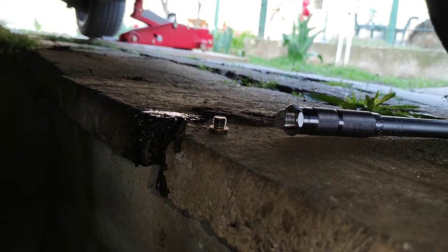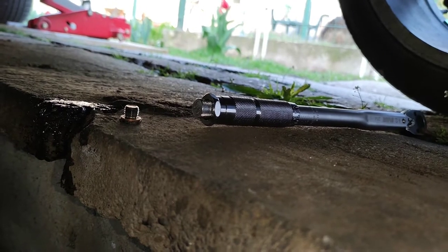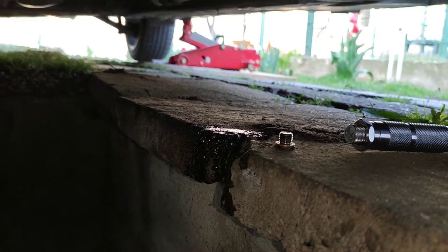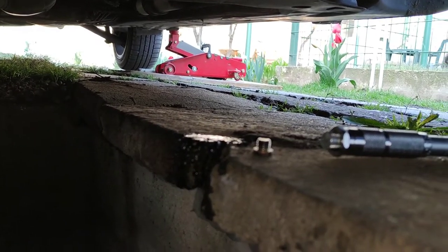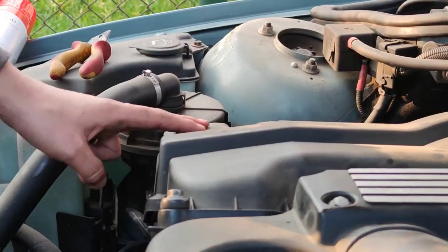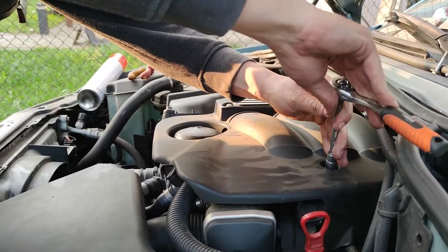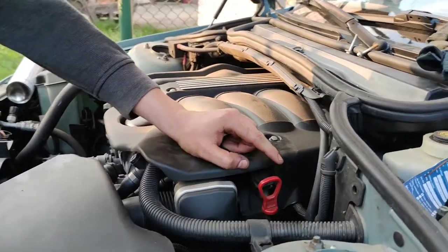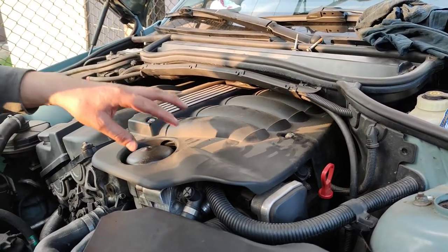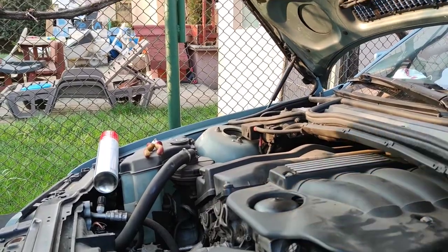Oil is drained. We have a new washer for the oil plug. The torque wrench is set to 30Nm and we're putting back the oil drain bolt, then filling up the engine with the required amount. Now that we've put 4 litres of fresh engine oil in, we've closed the cap, started the engine, and let it run for 5 to 10 minutes. Then we stop it and check the oil level — it was a little bit between minimum and maximum, but that's okay because the oil filter will probably absorb 200–300ml of oil. We can put back the plastic covers.